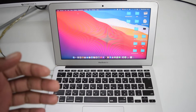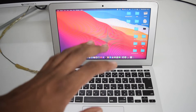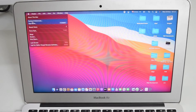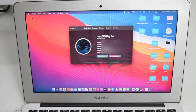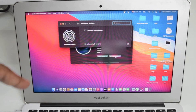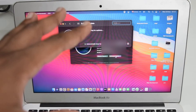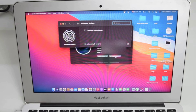In step three, we're going to check if your MacBook software is up to date. It's important to keep your software updated. Go to the Apple logo in the top left corner, tap 'About This Mac', then tap 'Software Update'. Your computer will search for any pending updates. Install any available update and see if it fixes the keyboard problem.